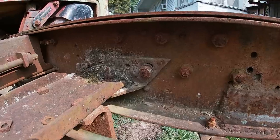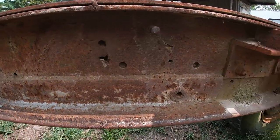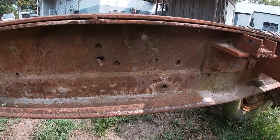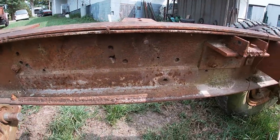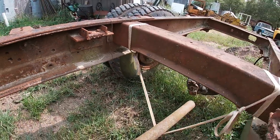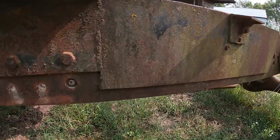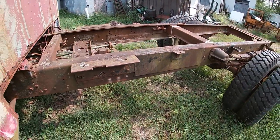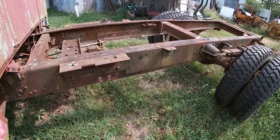You can see over the years this truck has had numerous repairs inside of the frame. I don't know if this truck had been lengthened at one time and then shortened again, but this is a little over three-eighths-inch thick steel on the inside. The outside has a little bit thicker steel as well — double framed. You can see where there was a bracket probably for that old bed that was cut out of here, and here's a plate added on the outside of the frame. This was common practice back in the day of cutting, shortening, or lengthening a truck, and as long as it was done right — which the welds don't look too bad — I'm not really concerned.